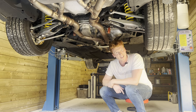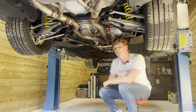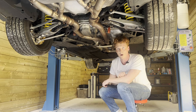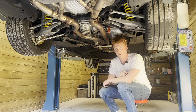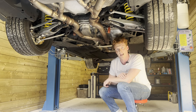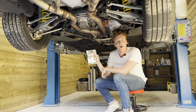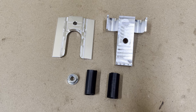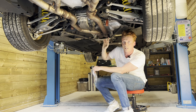The car is back up on the lift again. The completely real scratching sound you just heard is from the parking brake cables touching the drive shaft. The clip which holds the parking brake cables to the body of the car is made from plastic — what a surprise, BMW. Over time, this plastic clip fails, resulting in the cables dropping down out of its clip and touching the drive shaft, causing that scratching sound. So AGA Tools made a parking brake cable clip out of aluminum, so that it obviously never fails and outlives the life of the car. We're going to remove this part of the exhaust and the heat shield to gain access to the clip.